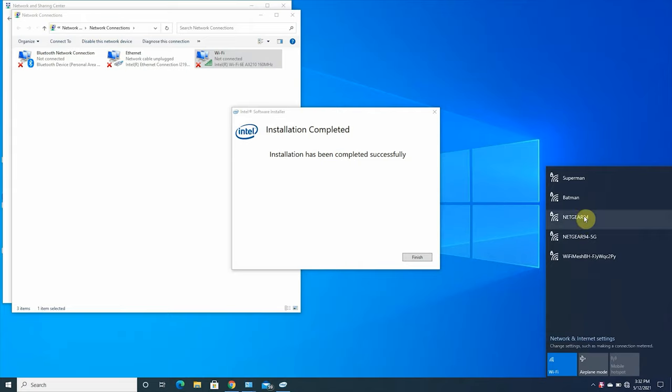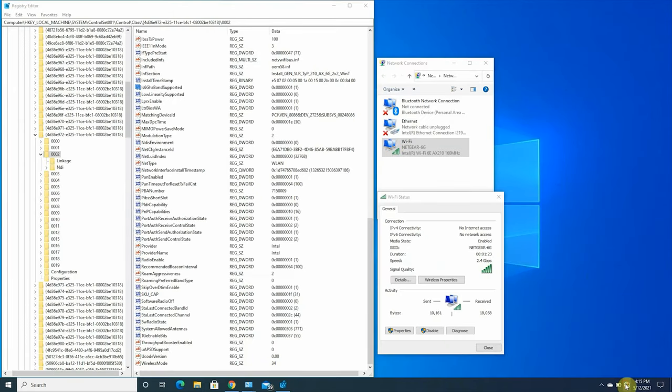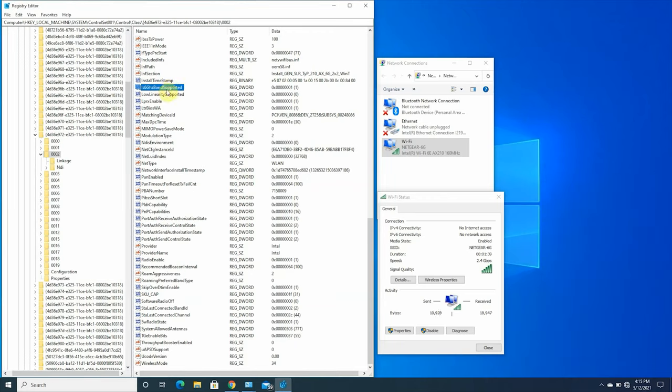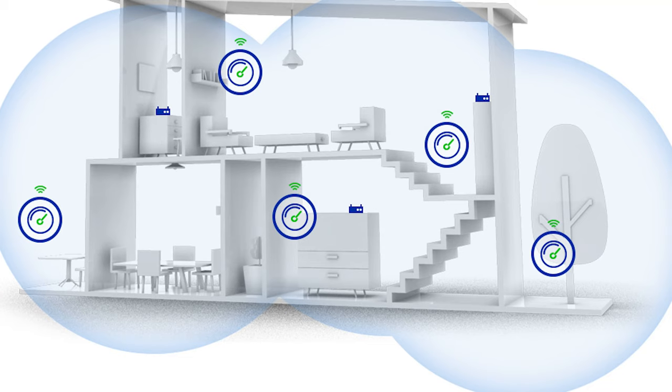I will post this information in the description below and on the Deal Unboxing website. Here are the steps: Make sure you're running Windows 10 version 2004 (the 2020 update) or higher. Install the latest Intel AX210 driver from Intel's website. Then run a command in the command window to confirm that OWE is supported and the latest drivers are installed. Then make a registry change to enable 6G for the AX210 wireless card. According to Intel, the latest drivers that will support and enable the 6G band will be available later this year.